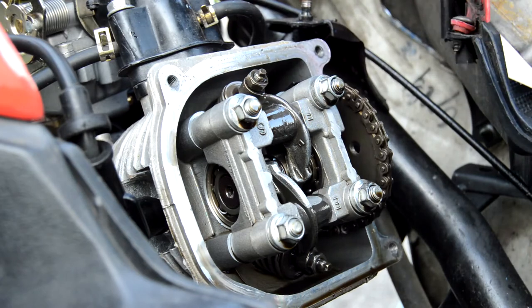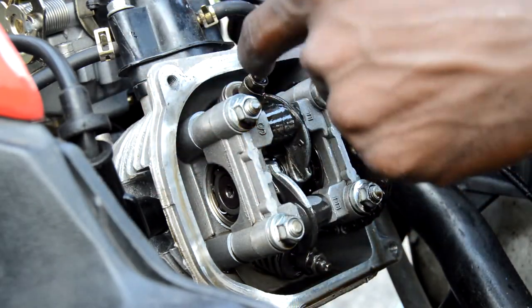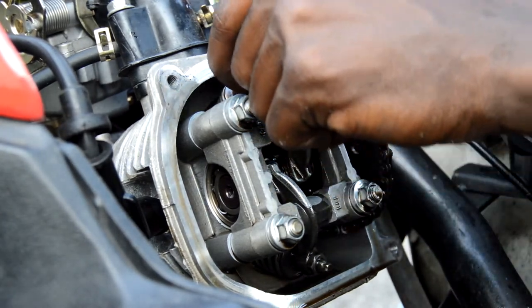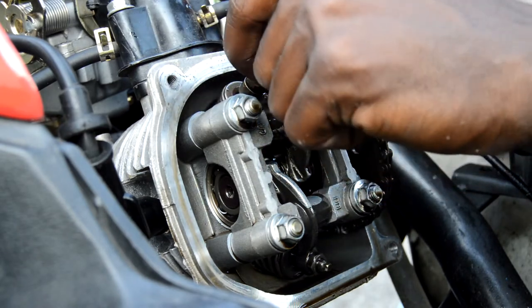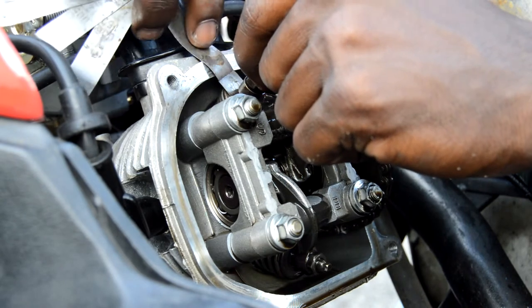The faster it's going to be hitting this tappet and there's going to be less room for it. That means you're going to be letting in more fuel into your engine the closer this is to the valve. So you want to get it to three thousandths of an inch — pretty close.